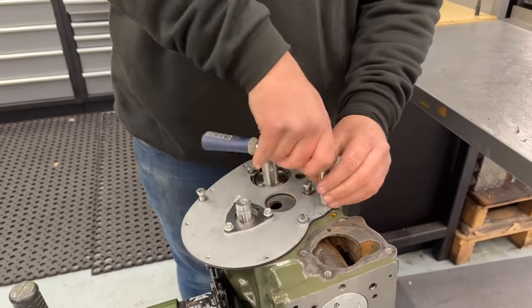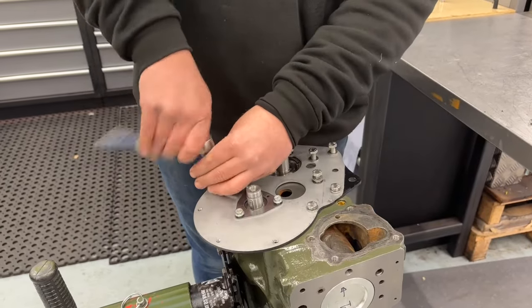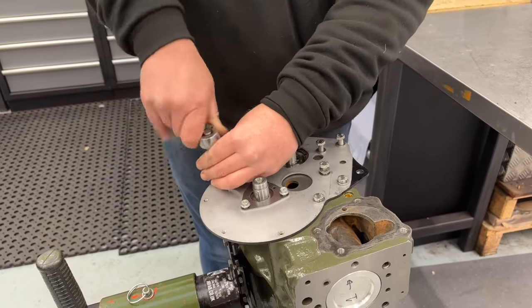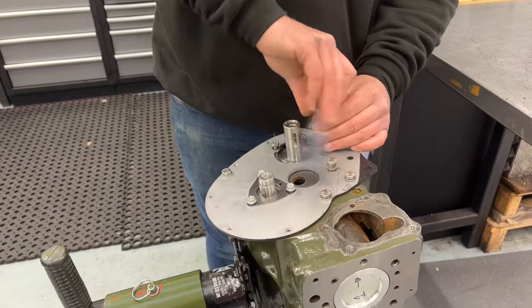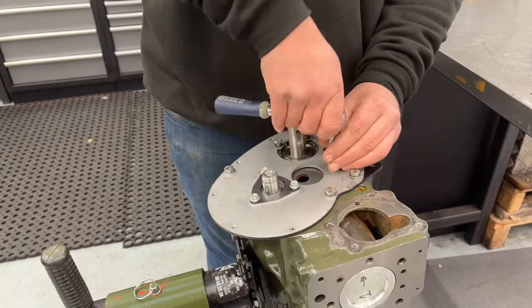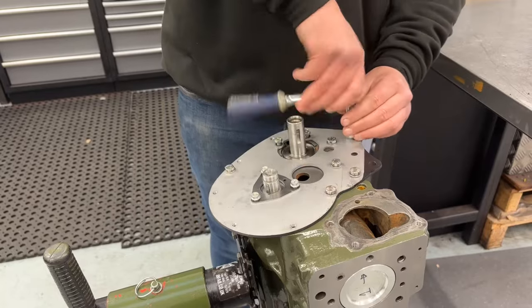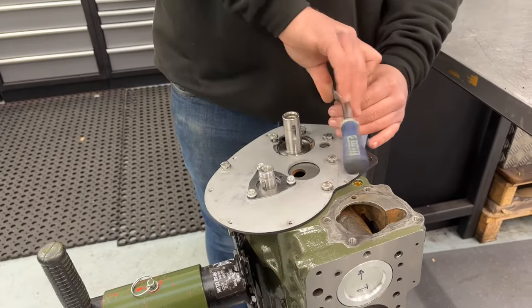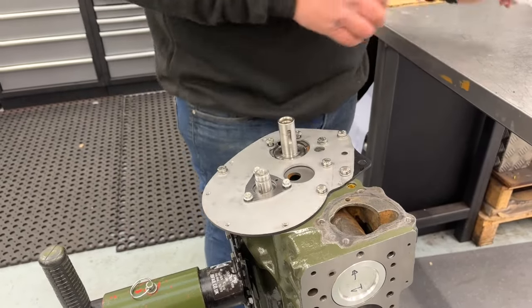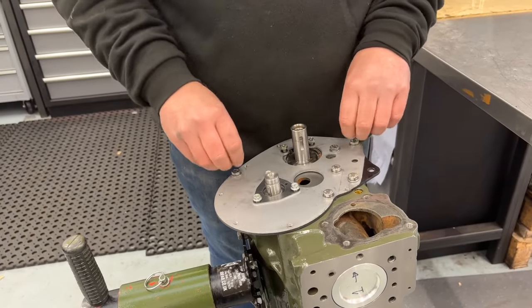What I like to do now, as we're working in this area and we have a gasket behind there, is fit the 5/16" UNF bolts that go in the larger holes on the timing cover to snug that plate down while the gasket material is going off. These are 5/16" UNF by three-quarter. I start every one of them in the hole to make sure the timing plate is lined up exactly where it's going.